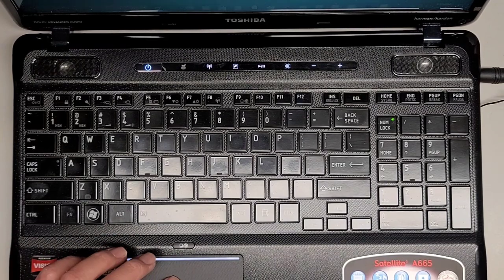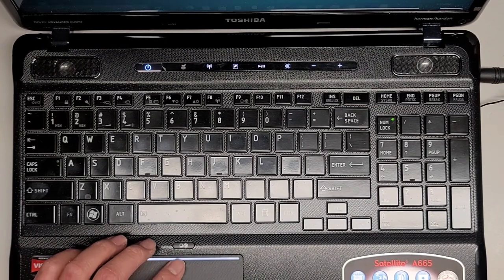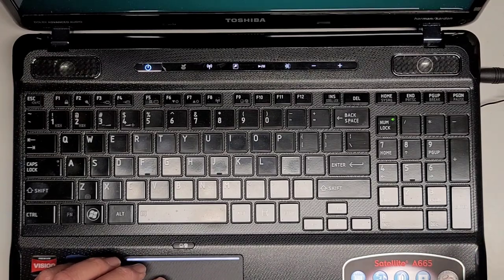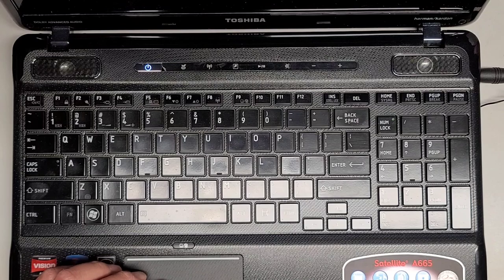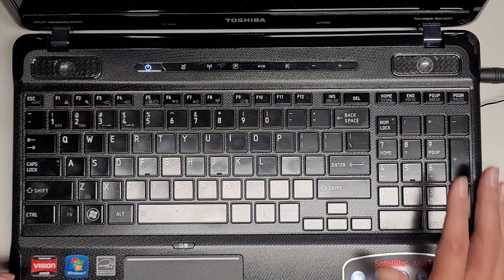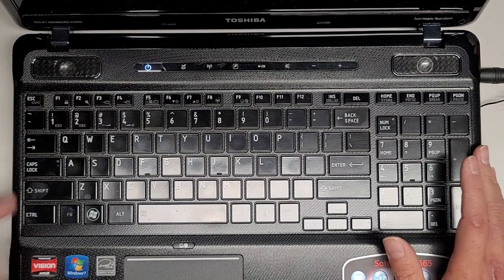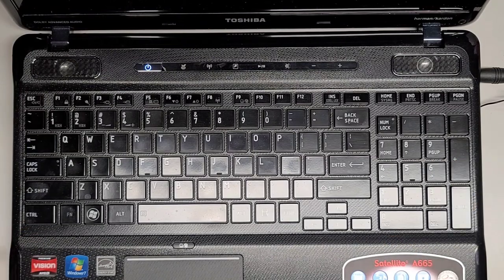Anyways, that's pretty much it. We're gonna shut this down, and I don't know, the hard drive is randomly making like click, click every so often. The computer, other than that, is working fine. I would recommend they put an SSD. I'm gonna see what they wanna do. I have a feeling they're gonna say, well, it's an old computer, so they're not too worried about it, but I don't know. I think their other computer, it was bad. I put an SSD, it made a huge difference, and they were happy with it. So maybe they'll actually want to go with that as well on this one.